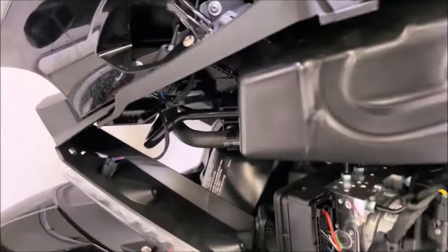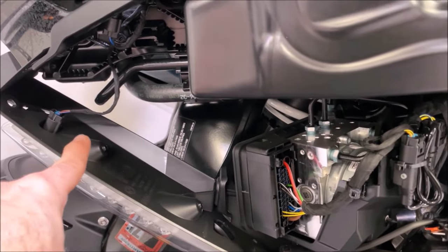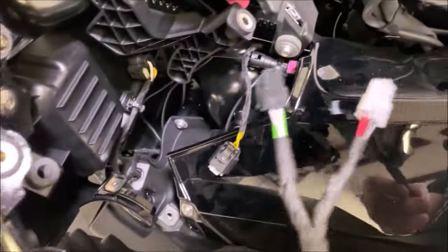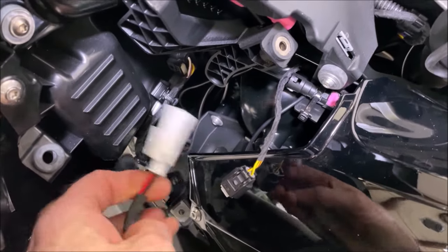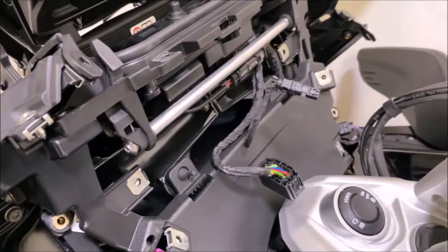Your amplifier is going to be nestled right here between the brake system and the front with its bracket. You'll need your wires to shoot up in this area. Grab your harness with these ends and fish them right down through here to the other side — it's fairly easy to feel your way through. You'll have your shorter length of wires to plug into the OEM connector, and the new pod connector here, and the longer one will run across and tuck behind to the other side.